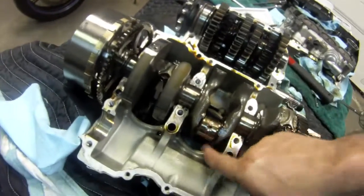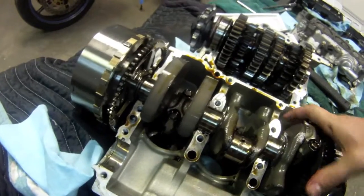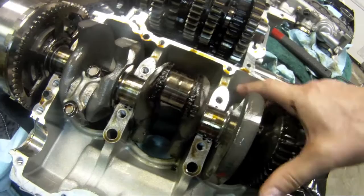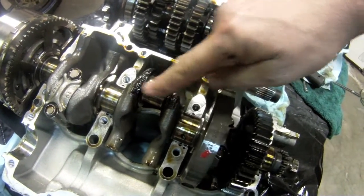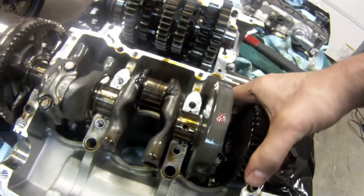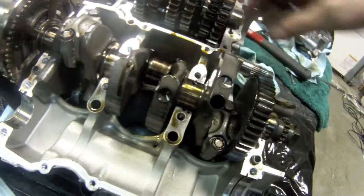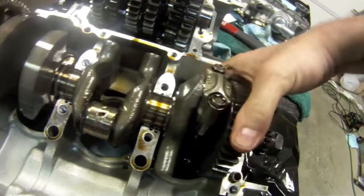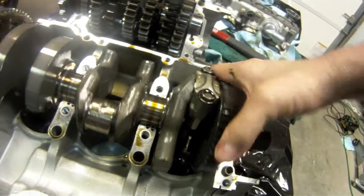The crank's damaged here — we can see that. Let me turn this slowly. It's got more scuffs on it there. For whatever reason, that looks like a bearing seizure — that got really, really hot. I don't know whether we stopped getting oil to that bearing or what. I can see some damage here on the crank; that's not too severe. But that journal — I don't know if that can be repaired. I'm not a crank expert.